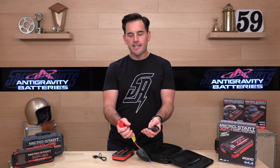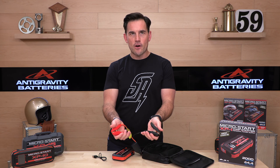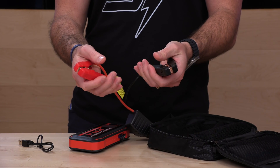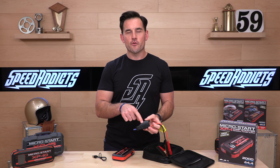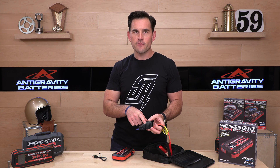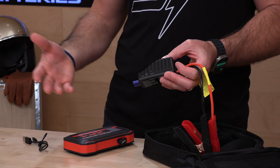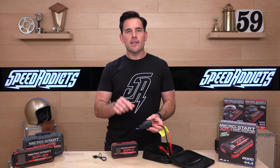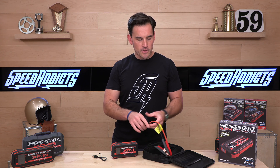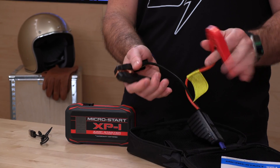That's what the clamps look like. As you step up in the range, you also get beefier terminals that are better for starting bigger vehicles, especially if you're going to run them several times without overheating. These are perfectly suitable for light-duty trucks and cars. Once you plug it in and attach it to the vehicle, you will get a green light — green means go, you're ready to start the vehicle. Turn it on, plug it in, see a green light — it's that easy. You'll get several starts even with this XP1 on cars, light-duty trucks, and side-by-sides. If you see a red light, your connection's screwed up and you need to look closer. There's a user manual — follow the instructions so you don't hurt yourself or others.